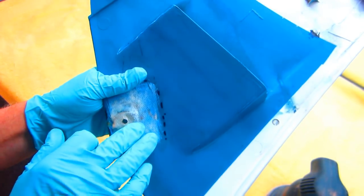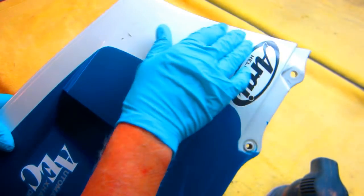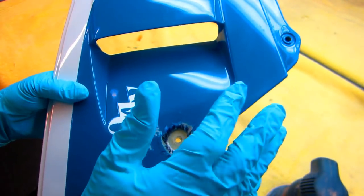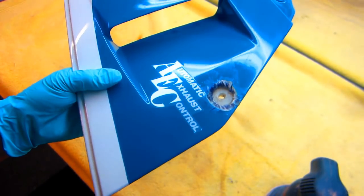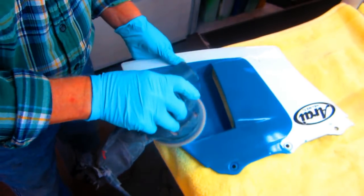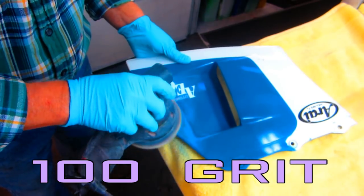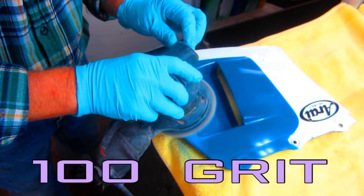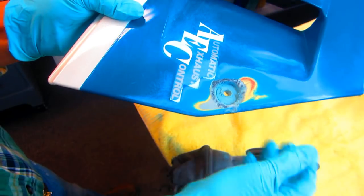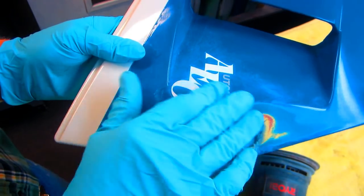The first step is this piece that Mark did the reinforcement on the back - it has one repair. I've got to sand this, sand off all the decals, and there's a repair up here. It stacks the deck that you're not going to have the paint crack further into the job. What that's going to do is get this part relatively flat - it'll take the decals off, but then I have to do the final sanding by hand.